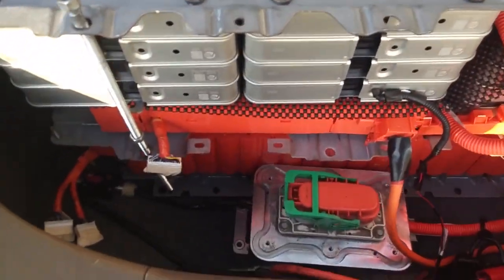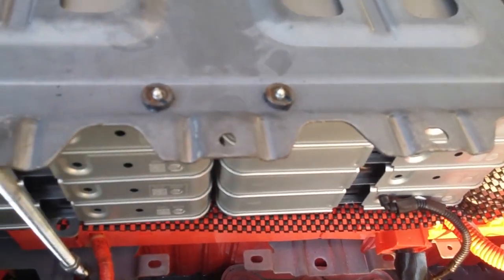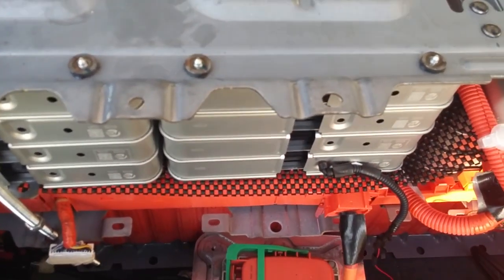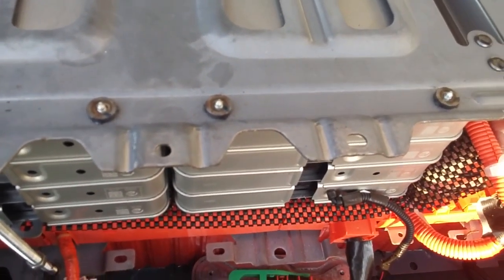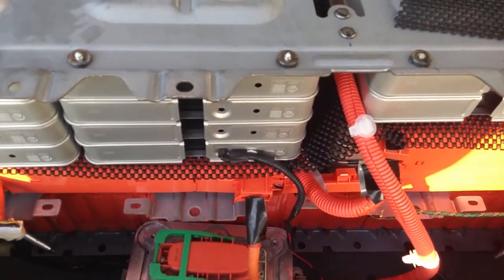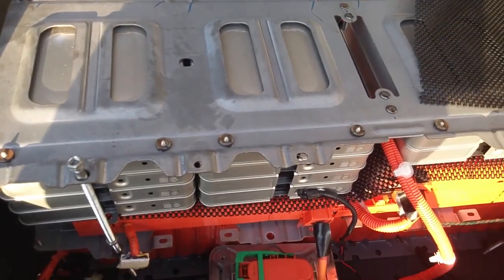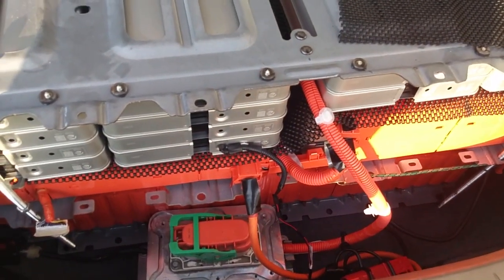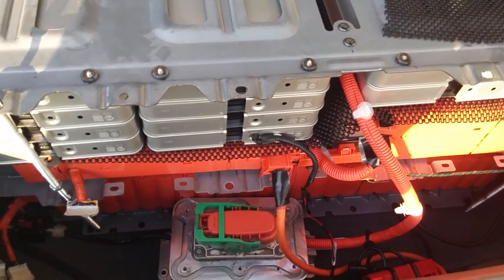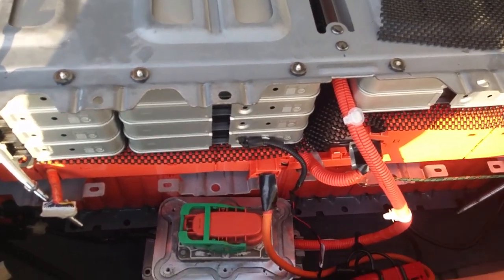This gives me good mileage — I only use this rod to hold it together. When I tried to tie this thing down to the body of the car, I was getting high voltage leakage to the body, and that was not good. High voltage must not get to the 12-volt system that runs the electronics of the car, so I had to insulate the whole thing from the car. This degraded battery along with the one underneath the car — also degraded — is giving me 80 usable miles, which is more than enough for me to go to work and come back home daily.